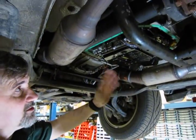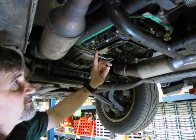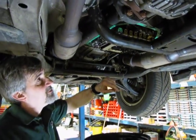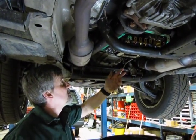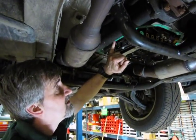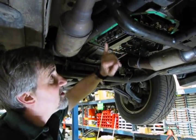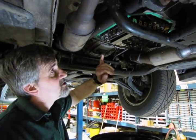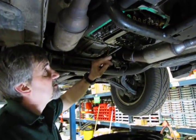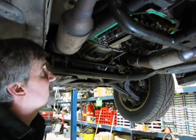Also at this stage you may want to change the filter — you're here, you've got the pan off, the fluid's down, it'd be a good time to change the filter over. This is a replaceable filter, it's just a matter of a couple screws and that'll come down. It is available through our maintenance and repair kits so you want to look that up. You're also going to need a gasket that seals the pan. It's always a good idea to replace the gasket and definitely replace the filter if you've got more than 50,000 miles on the one that's in there.